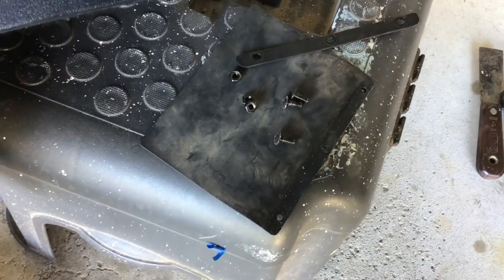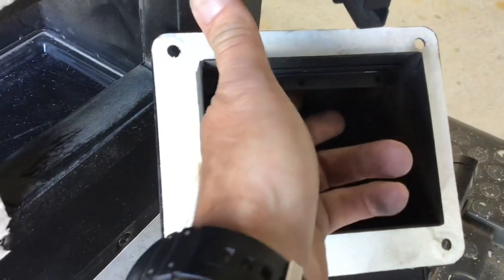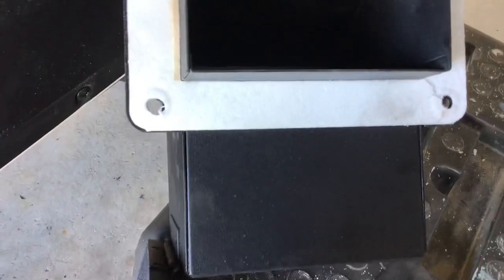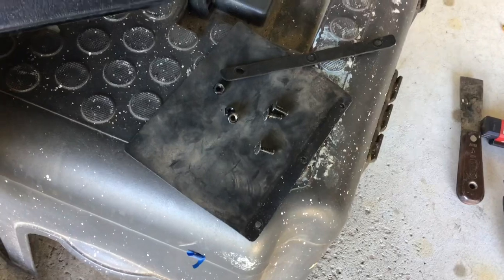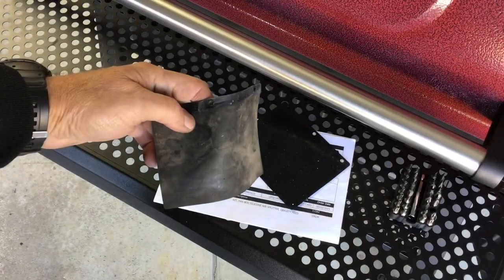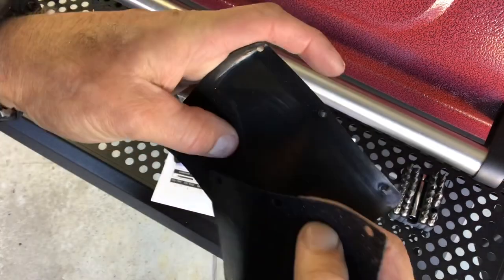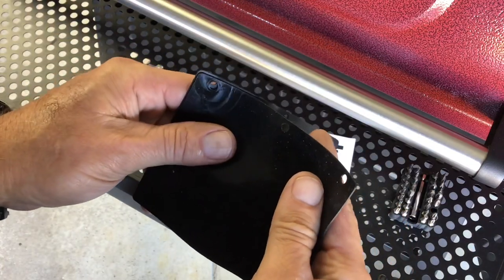Got the little one out, and guess what - there are nuts on the back of them. I loosened them up and they weren't coming off, and then I realized there are nuts. You have to put your hand behind the flapper and put your fingers up in the hole underneath and hold the nut. The nuts are going to drop down into your fan so you've got to shake them out or turn it back over to get all three. That's nuts that you would do that, but that's the way it is. Now let's take a look at the old one versus the new one.